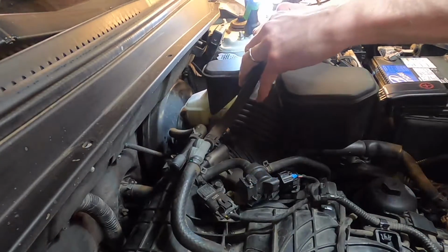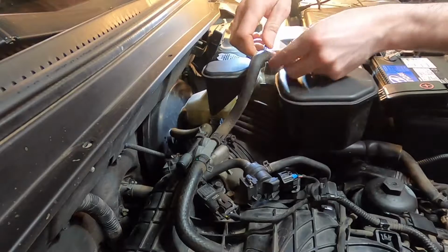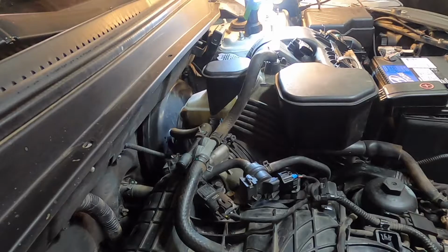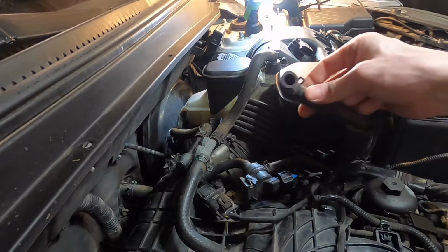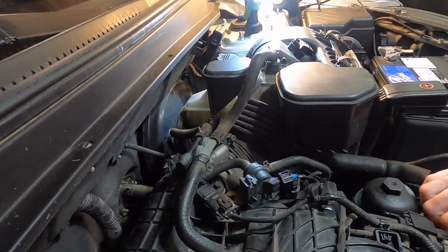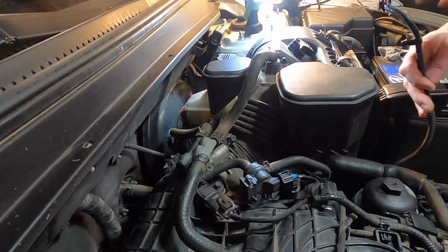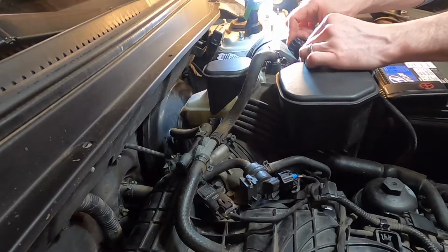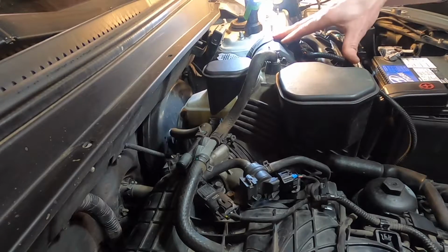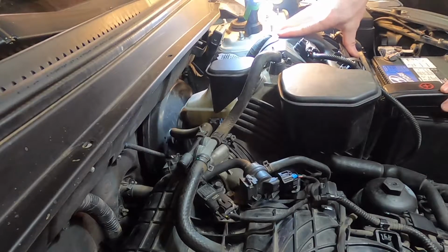And we got a hose here. Slide on, and do up that spring clamp. You might need pliers. I just used my fingers. And then we got a hose down here that goes to our valve cover. Slide it on. And make sure you don't forget this wire. It kind of flops down out of the eyesight. But this wire is what plugs into this connector on your airbox, and then there's a little retainer clip there. Now there's 3 10mm fasteners that hold the box in position.